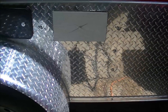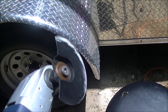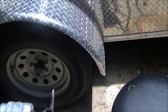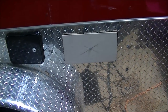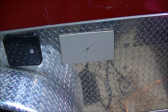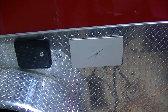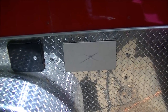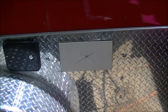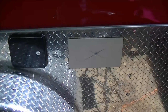After we got everything marked on this one and we're going to do the same thing here, I took my multi-tool — my $40 Harbor Freight multi-tool — with a metal cutting blade. This half-moon blade is a Harbor Freight metal cutting blade, about eight or nine dollars for this one. First we cut through the metal. We've got two layers here: the aluminum diamond plate and the aluminum exterior skin on the trailer. We cut through both of them. If you recall in earlier videos, we installed backing plates in between the studs, the same thickness as the studs on the inside. So there's solid wood behind that, plus layers of insulation — there is a one-inch-thick solid wood piece directly behind this wall right here.